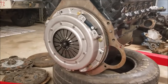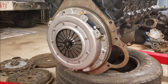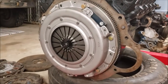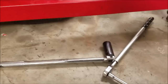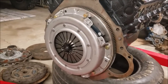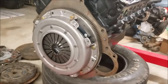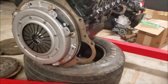I got it all mounted up. Unfortunately my camera took a picture instead of recording, so I'll explain what I did. With a lot of these clutches it's really hard to get in with a socket and get a proper torque spec, so if you can't, you can use a regular wrench to run it down. I don't normally advocate for that, but with these setups you're kind of fighting the clutch pressure itself as you tighten it. Once it's down, the clutch disc is held in by the pressure plate so you can pull the alignment tool out. Lock washers also distort your torque spec, so just be sensible about it.